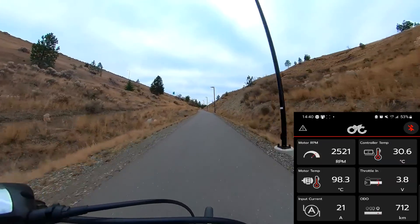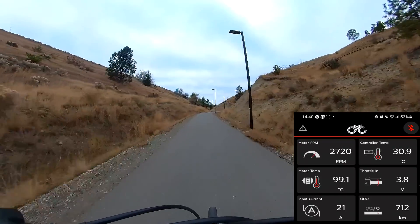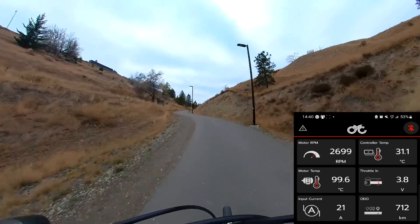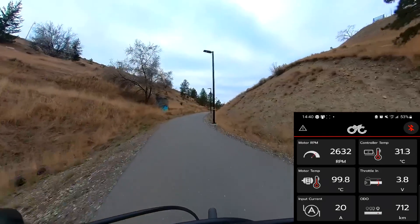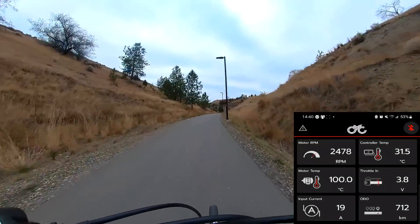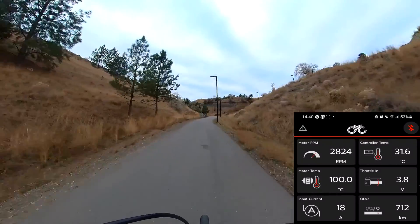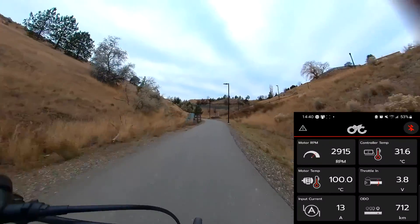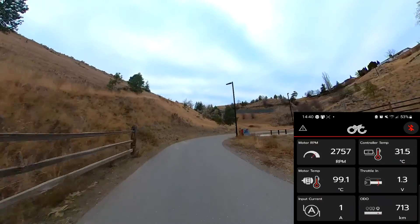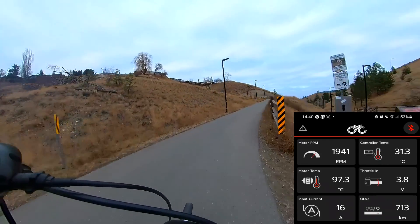You can see this in operation with the video I did today. Inside the motor it was reading over 100 degrees C, but on the outside of the casing it was pretty cool — I could easily hold my hand on it. The controller and the area around the reduction gears was warmer to touch than the casing surrounding where the motor spins. In the summer when it was 30 degrees C and over outside, the whole motor did eventually get hot, but still not close to the internal temperature which was over 100 degrees C. The effect of all this is that especially in the summer the motor will rapidly build heat to the point of throttling.